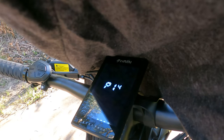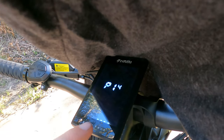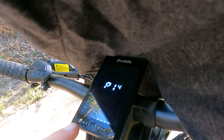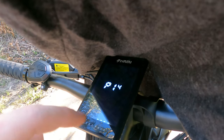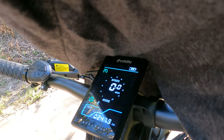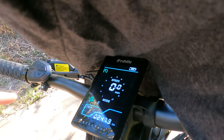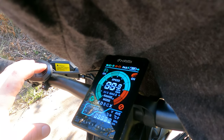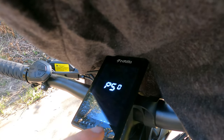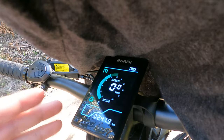P14 is to set your security code for your scooter. These scooters do not come with a key, so I highly suggest you put in a manual key so you do not get your scooter stolen. It's a four-pin key. When they're brand new they are usually zeros, and once you've gone into that you can change the code to whatever you desire using the up and down arrows, pressing M to go across. When you turn the scooter off and power it back on, it'll ask you for that pin, and once you enter it the scooter will turn on.